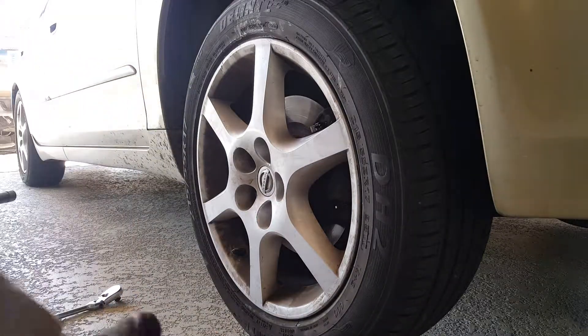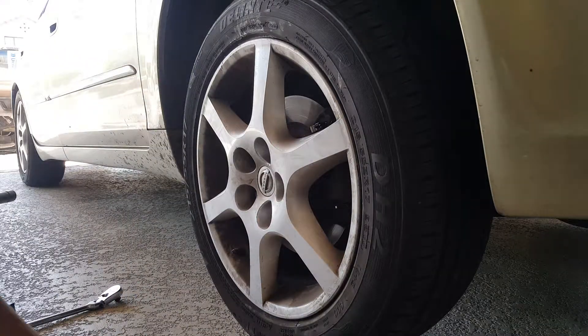And that's pretty much how you do a brake job — it's the exact same thing for the other side. Make sure after you lower the car that you tighten the lug nuts — that's the most important thing. The second most important thing is make sure you pump the brakes after the job, because you pushed the piston all the way in, so there's a little clearance between the caliper and the brake pads. You just want to close that clearance and then you'll be good to go. Thanks for watching, until next time!